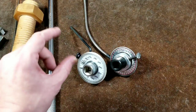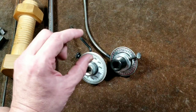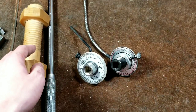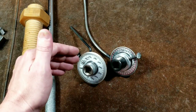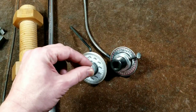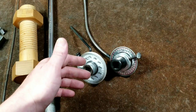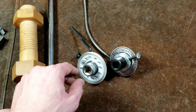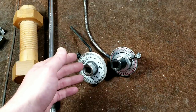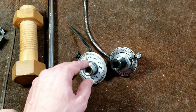The manufacturer knows that you've gotten a nice, even clamping and seating of the parts with the 50 foot pounds. Then the 90 degrees is what's really going to provide the cinching and it's calculated. If you turn a fastener 90 degrees based on a certain thread, it's going to move a certain amount and you can calculate how much force is applied. On a big 16-liter diesel engine, sometimes the base value will be 300 or 450 foot pounds, and then you'll turn it 90 degrees or even more after that.